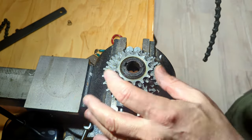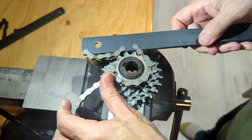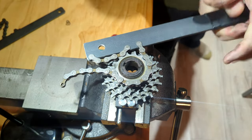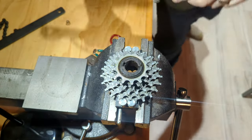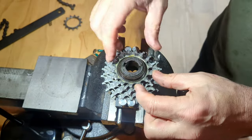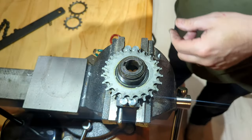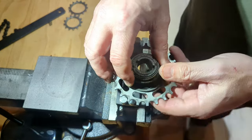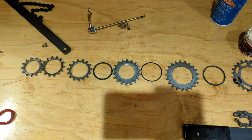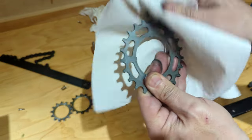It really looks good with proper lighting. If you don't have one of these freewheel vices, you should get one — it holds onto the biggest cog so you can loosen them one at a time. This is going to take some grunts. There we go — one, two. Got a spacer here, that lifts off, and the last one's a spacer too. When you're done, make sure you lay them out in order so you know how they go back together. These just clean up really nice — very little wear on this thing.